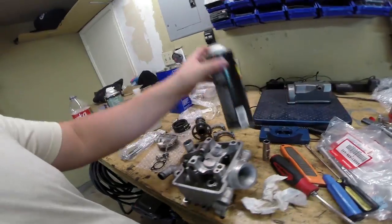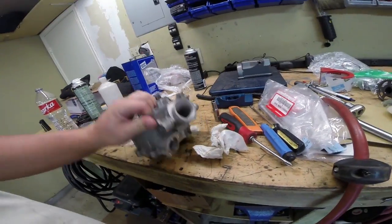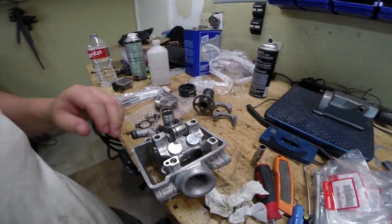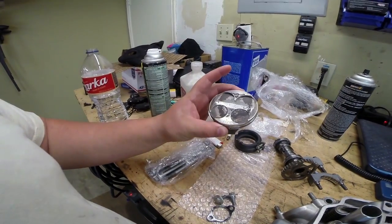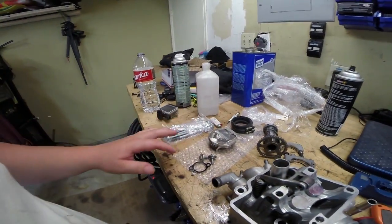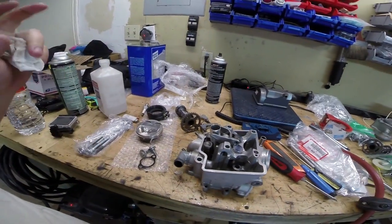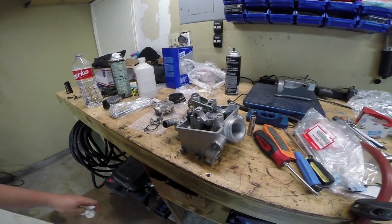Good news, we finally got our head. This guy did a phenomenal job packing everything up — shipped me everything including the old head bolts for reference, and this came all assembled. A really clean head. Looks like somebody's done a little bit of hand porting on the intake. There's a little bit of wear here but nothing too bad — this head is super clean, valve seats are nicely cut. The piston he sent shows this is a Wiseco high compression piston as well, same as what we put in. I'm going to go ahead and reuse the cam and all the valve train that came with this head because in my experience it's best to reuse stuff that's already mated. We are definitely going to use some assembly lube to get it all together.